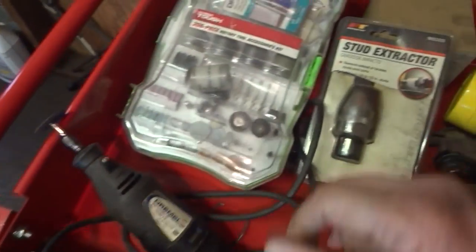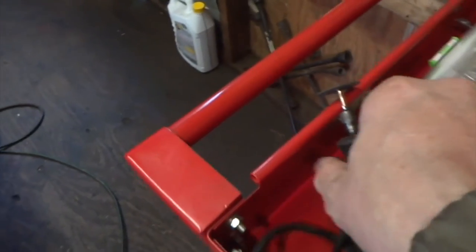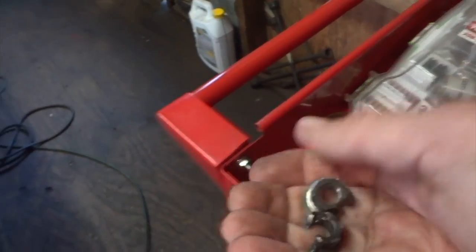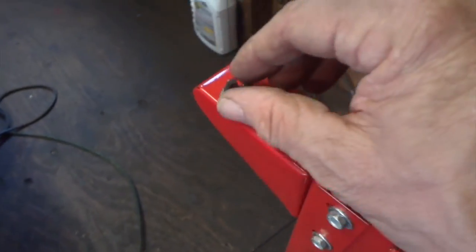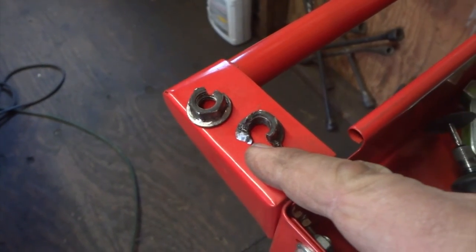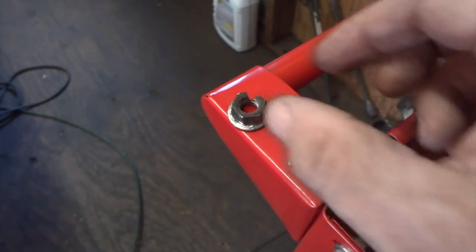The one I had that was working — what's left of it — is in there, it's pretty much shot. So what I did, I took the cutting wheel, put my hand up in there, and kind of got it rested. And here are the nuts that I took out. What I did, I sliced the side of the nut right up next to the threads. Try not to cut the threads too much, and not quarter this off. When you do that, this will loosen it up and you can get these off.